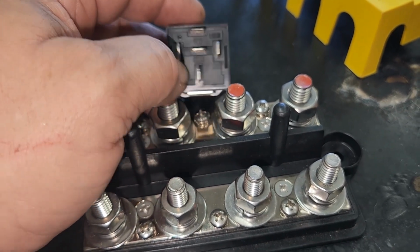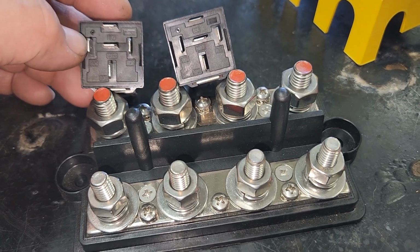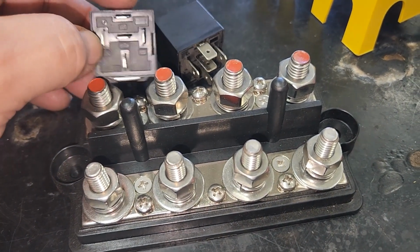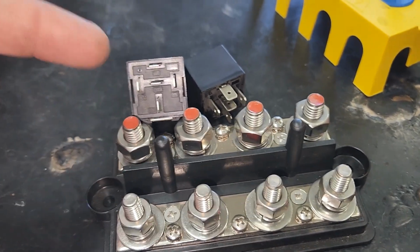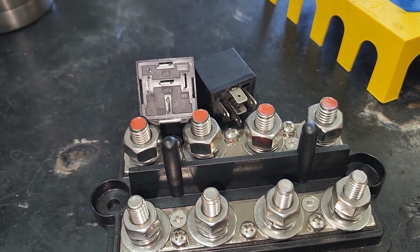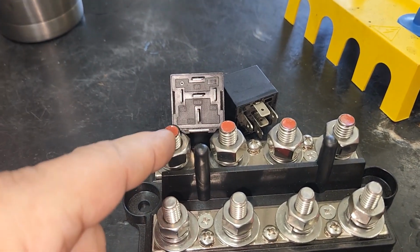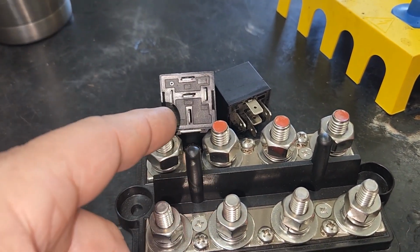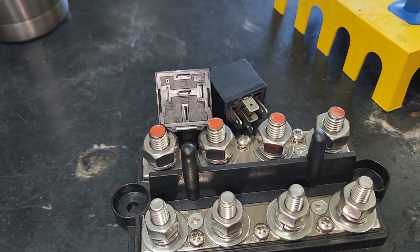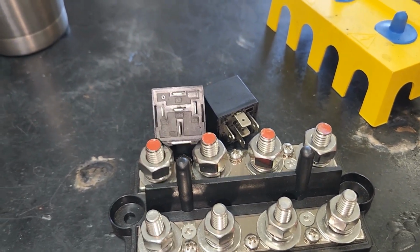Now, the Hobbs on the second pump, for now, the way I'm going to do this is I'm just going to unhook one pump from here when I'm not using it. I'll just unhook it from here. But when I'm going to make a pass that's going to have more than 4 pounds of boost, I'll just hook it back up before I go to the staging lanes or in the staging lanes.